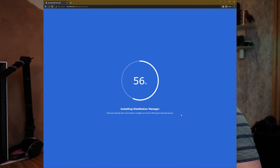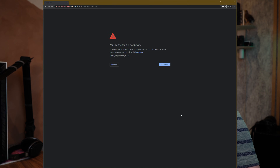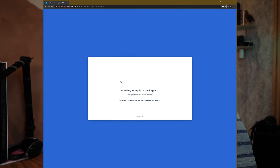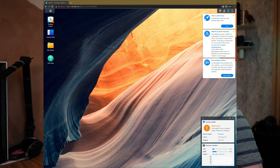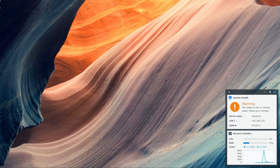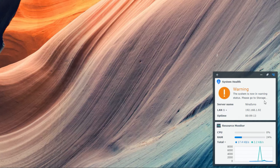The migration will now run and we just have to wait. When it's done it will try to navigate you to the DSM software. You might see a warning saying the certificate is untrusted — just continue through that warning since we know this is our NAS on our local network. Now you can log in with your old credentials and everything is as it was before.